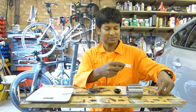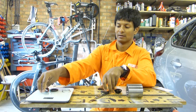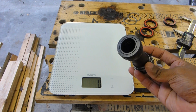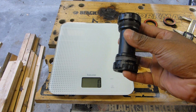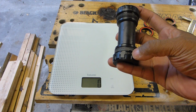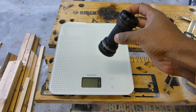The major advantage with the Cannondale system is the system weight. So it just consists of two bearings and two snap rings, just like that. So the combined weight is very small. So if we just weigh them. So for system weight, I've gone and got a standard Shimano bottom bracket. It's threaded and it's an ISO standard or BSA bottom bracket. So it's 1.37 by 24. That actually means 1.37 inches by 24 teeth per inch. That weighs 65 grams, so that's bearings, sleeves, everything, put that through.